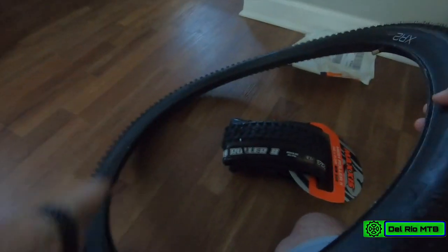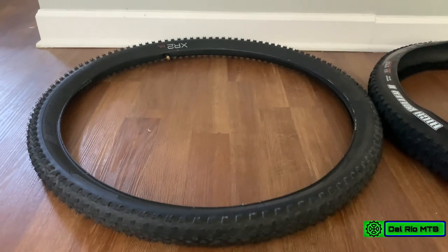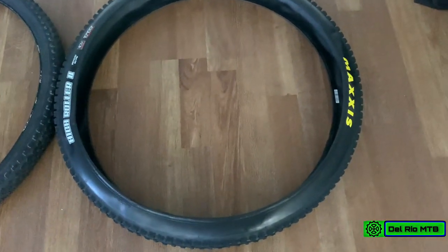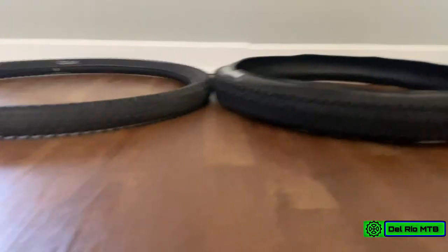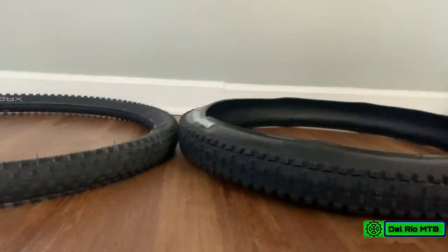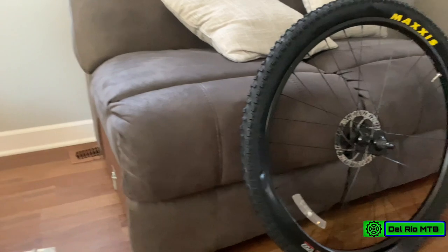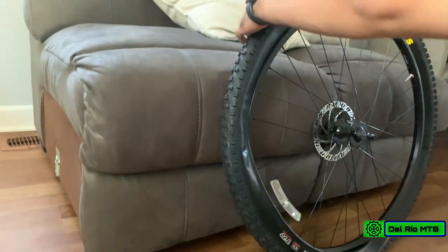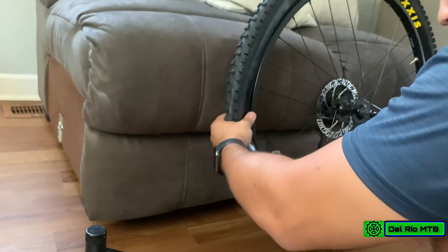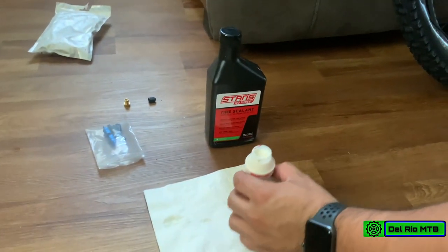I ended up getting a different tire - the original one on the Marlin, when I took it out, I had trouble sealing the bead so I figured it's probably stretched out. I tried wrapping the tire with a rope but it still didn't work. This is the original tire and this is the one I'm replacing it with - the High Roller Maxxis. It doesn't do it justice on video but when you hold them together you can definitely feel the difference; the tread on the High Roller is really nice. I finally put the tire on - it's a lot easier compared to the old one since it's not stretched out. I'm going to go ahead and put in this Stan's tubeless sealant.